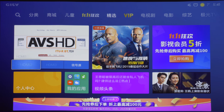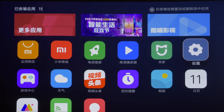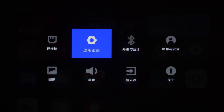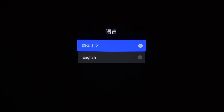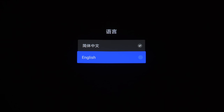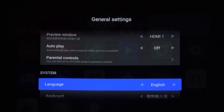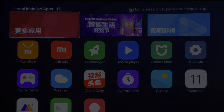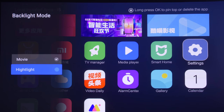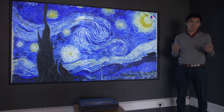Go into the MyApps folder, scroll right to the gears icon which will open the settings page, click on General Settings, scroll down to Language, press the right or left button on your remote control which will switch it to English, then click on Confirm, and voila! The majority of the UI should be in English, although with the occasional spelling errors. I wonder if "unread massage" means that you can't predict where the hands will go next — just take my money right now.